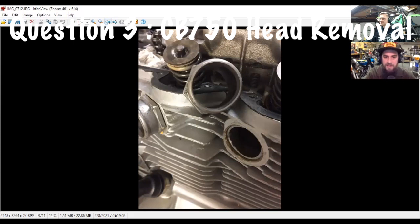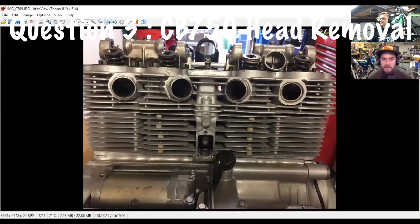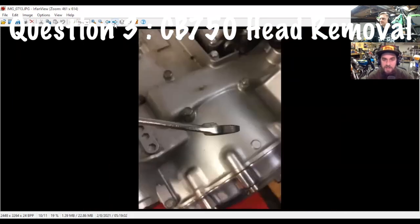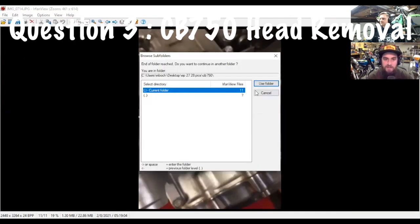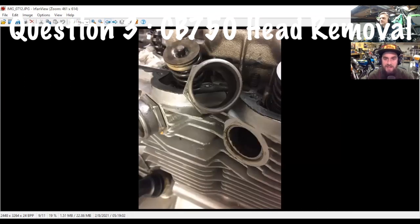Now for your advice. I have tried everything I know to remove the head without success. I used a wooden drift, a stake and lump hammer, a heavy-duty mallet on the parts of the head that would take a significant blow. I've destroyed several wooden drifts, used copious quantities of releasing fluid, and left it for days to penetrate. Unfortunately, as you can see, I slipped off the hex on the inlet port tube, bent it, then sheared it off. That sucks.